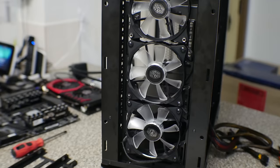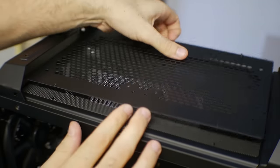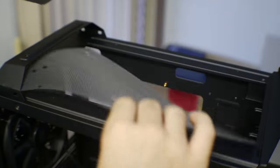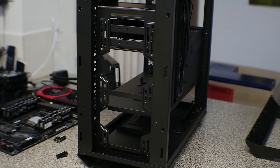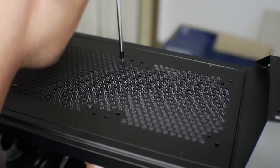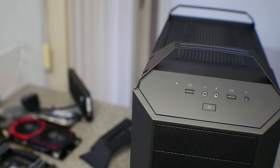The options for radiators can also fit a 120mm on the back, a 240mm on top, and a 360mm, with dust filters extending to the top, front, and bottom. I did find at the top, however, I could only screw off the rad at only 6 of the 8 points that the radiator had support for, and I had to remove the dust filter to do so.